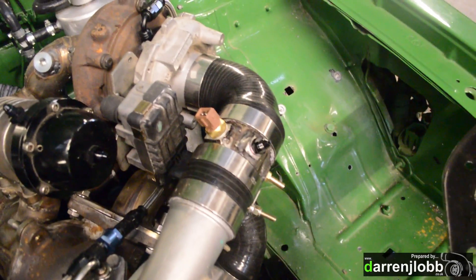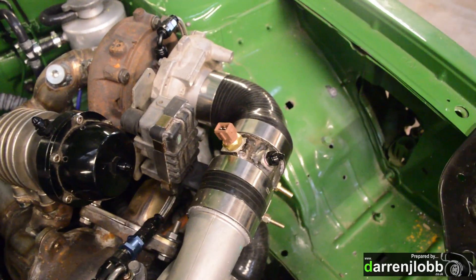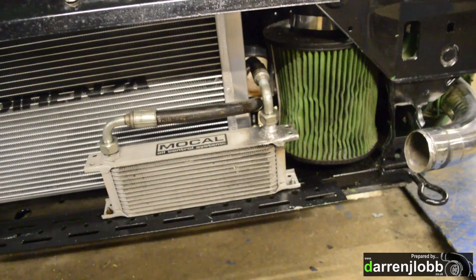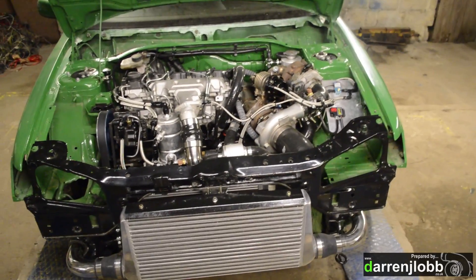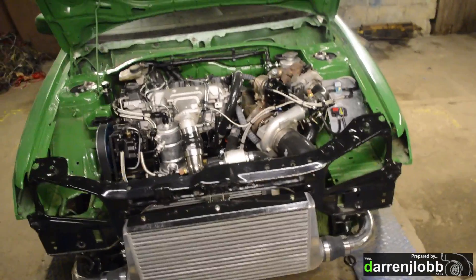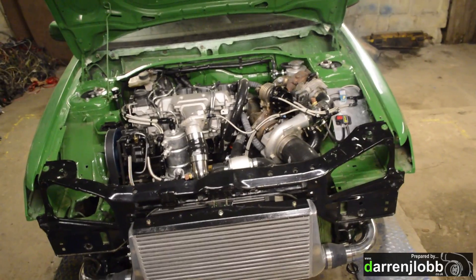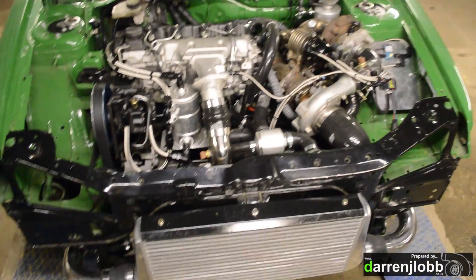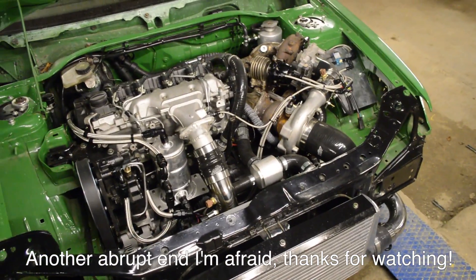That little piece is clamped in now. You can see we've got the three sensors there — one for the MAP sensor, one for the boost control, and the air temp sensor. That's all clamped up and ready. I also just bolted up the oil cooler in front of the radiator there — that's pretty much as it was before, nothing changed. So mechanically we're pretty much all together now. The fuel system is finished, the cooling system is finished, all the turbo and intercooler pipework is done, all the sensors are mounted where they need to be, and the intercooler is all plumbed up. It's really now just the electrical work to do.